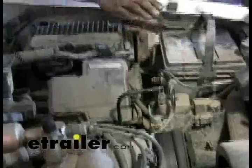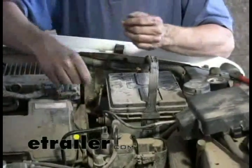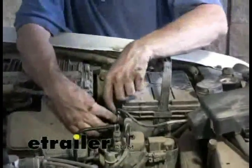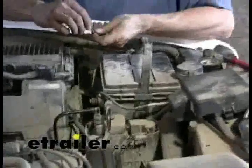In this case, I think we will go ahead and use this battery here. This truck actually has two batteries set up; we'll go ahead and use this one — it looks like it's in relatively decent condition. There are a variety of ways you can connect to this. You can simply take the wire and a large ring terminal and install it between the post and the ground wire right here. There are also little brass tabs that you can loosen, do the same thing, and reinstall.